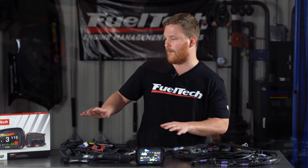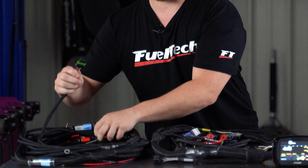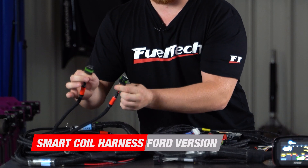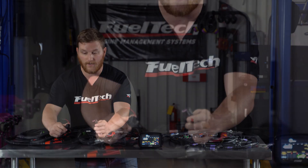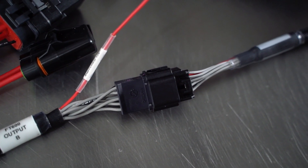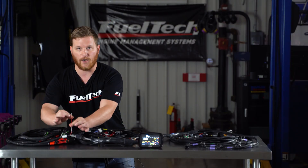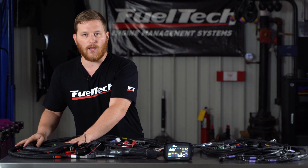This is a nice addition to the Pro FT550 Ford harness — it is our smart coil harness to use with the IGN-1A style inductive coils. It plugs directly into our gray outputs connector on the Pro FT550 or Pro 600 harness, so you just plug it in like that. Then you generate an output for RPM activated output and turn power on here for your coil relays. The rest of the wiring is super simple. You just hook up your grounds that go to the cylinder heads and also hook up your main power and ground wire that go directly to the battery. Plug in your coils, route your wires so they fit nicely in your engine bay, and now you're able to run coil on plug.